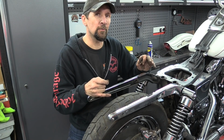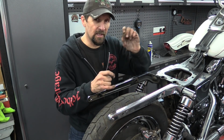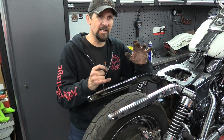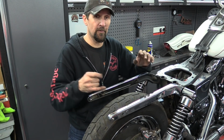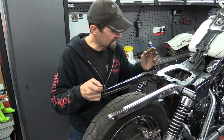You don't necessarily have to repaint an entire part because you've got a little rusty bit down inside. Just stabilise it with some touch-up paint, bit of zinc oxide or something, so it doesn't get any worse, and you can retain that factory finish, which who knows whether I go that way or not. Anyway, there we are. That's the back end out.